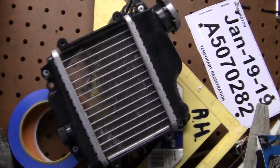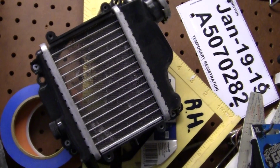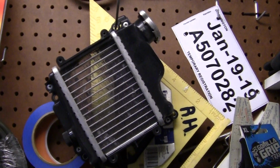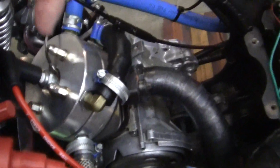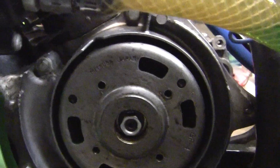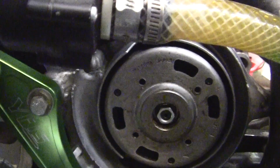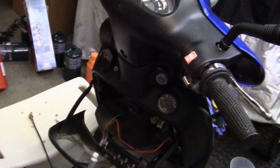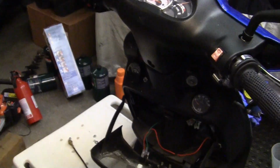These right here, there's one there and there's one up here. These are Honda Ruckus radiators. A few years ago I thought maybe I could get a couple of these off eBay and see if they would work on my bike. The neat thing about those radiators is that they fit right down here. The fan fits over that, and then right in front of it is the radiator. So the fan's sucking air through the radiator, and it's a really neat little setup. But when you're running this many cc's, I really can't tell you how many cc's it is because I don't want to scare you. All I can say is, DIO Speed Demon,